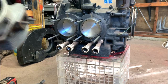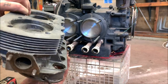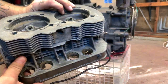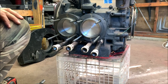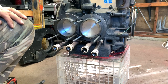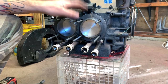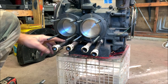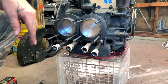Look at those new pistons. I'm going to clean the valves up on this head — they need cleaned and lapped, it'll make me feel better. The pistons are 86.95mm, so they're the 87mm size. I'm not sure if I'm using them yet on that motor because I believe that motor has really good pistons on it already, so I might save these for another adventure.